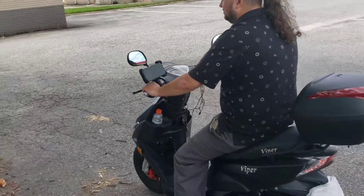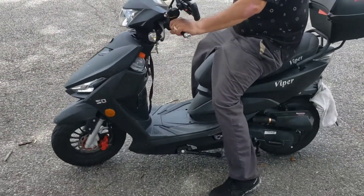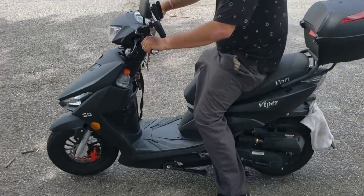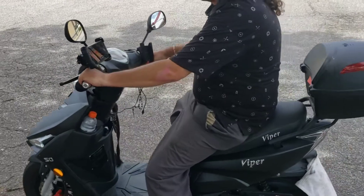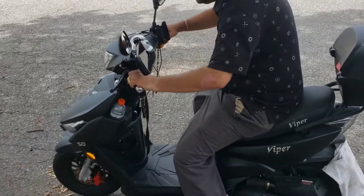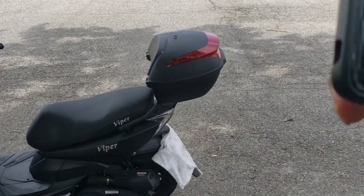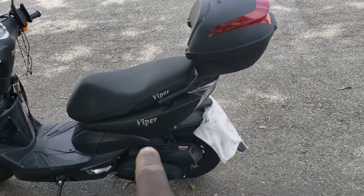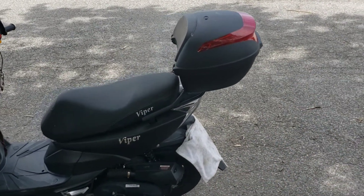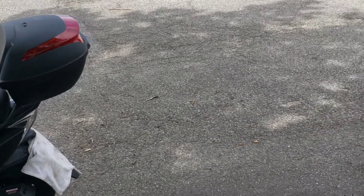So how does it feel? It feels more powerful. Yeah! I don't know about the top end but it's a start. Because I was just telling them it's not going to be a whole lot but that's a start. If we wanted to do more we'd have to really get a better needle and/or a better carburetor so we can start upping the jets. But for what you have with the CDI box, that's a nice step in the right direction. Now if you wanted to do an air box, that's when I would say we should go ahead and get a better carburetor, because if you go to a cold air intake that's going to change the whole way the bike runs — some people say go up a couple of jet sizes just by changing the air box, because you're getting more air, and when you get more air you need more fuel.